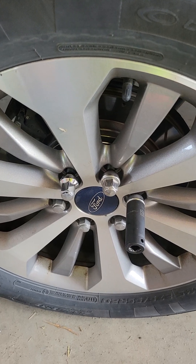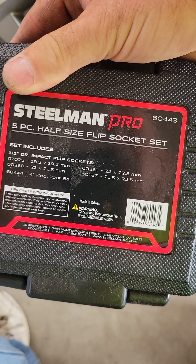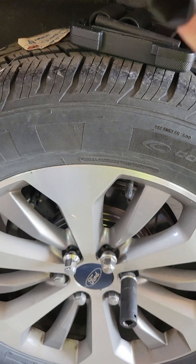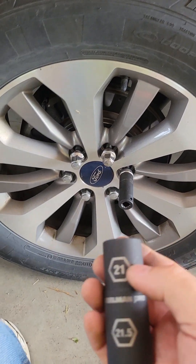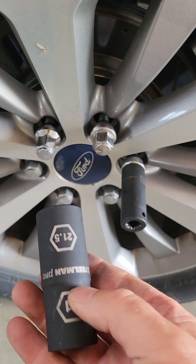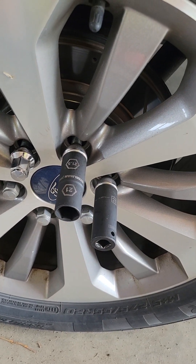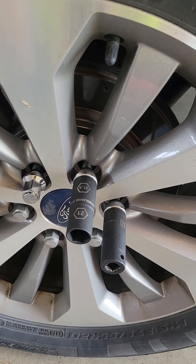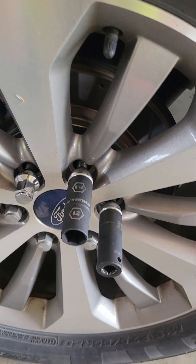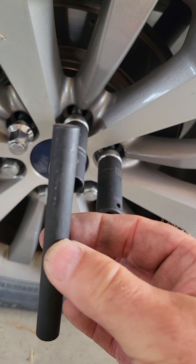The first thing you want to do is buy this handy little set of Steelman Pro half-size — their five-piece half size. These work the nuts, let me tell you. There's your 21, and then on your ones that are elongated or distorted, the 21 and a half will fit on a lot better than the 22, and it doesn't get stuck that much. I took them all off and replaced them. This set also comes with a really handy steel rod to pound the lug nut out if you have to.